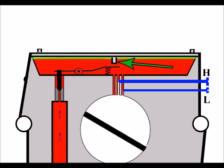Now, another problem that can occur, and certainly one I've had in the past with these metering diaphragms, is with this area here. This is the plunger that's part of the diaphragm or the dowel that activates this area here on the metering lever. And this is a tricky one because the rest of the diaphragm can be identical to the correct one, but the plunger itself can be too short sometimes.